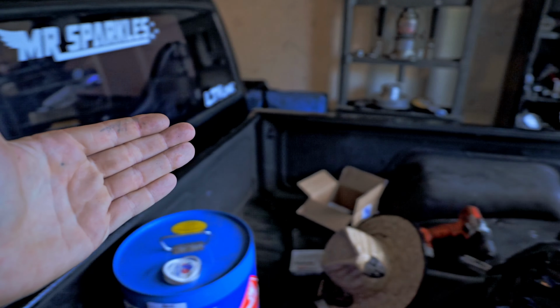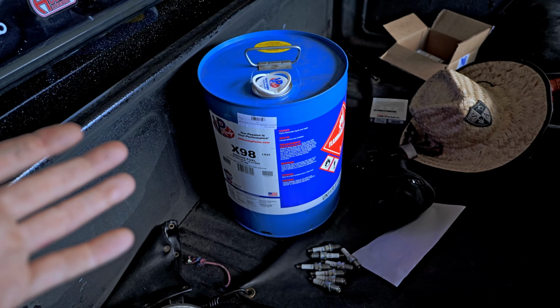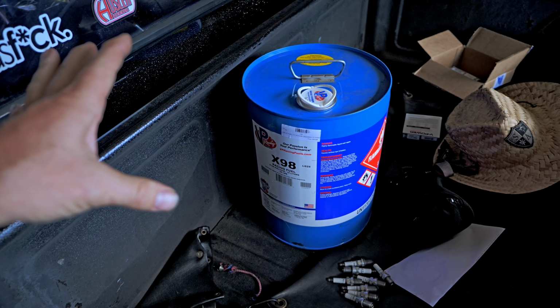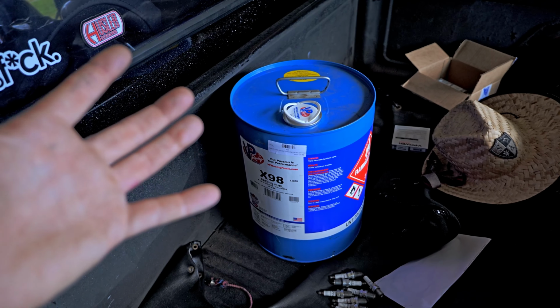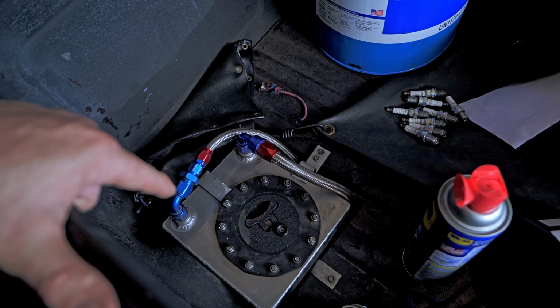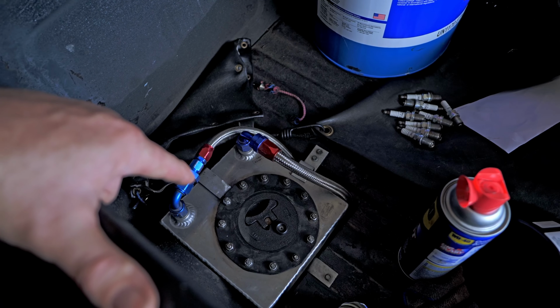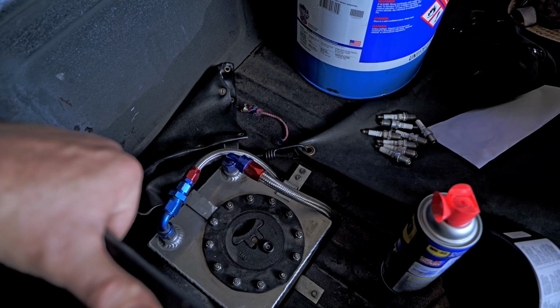But on nitrous, right here, it's a chemical process, right? The nitrous doesn't burn. What it does, under really extreme heat and compression, is break apart the nitrous oxide and release oxygen. So it's basically the same thing as a turbo, but it's a chemical process that releases oxygen. Now my guess is, since it's a chemical process, a lot of atom splitting is going on all over the place because it's actually splitting the molecules, right? So when that happens, I think the crappy 87 or 93 gas in E85 is why some of these guys have to run it so fat, is that gas is acting as pre-ignition.